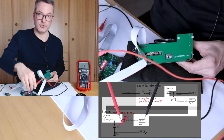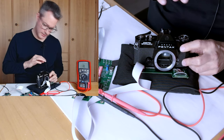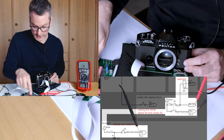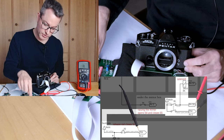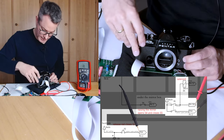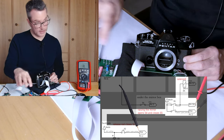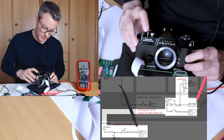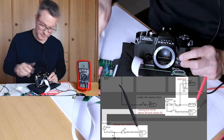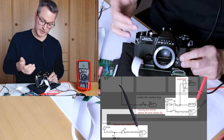There is another power supply contact operated by the mirror action — a switch for providing power to the solenoid that is only activated when the mirror is up. I have connected my multimeter probes to pin 2 and pin 10, checking connectivity between pin 2 (the switched battery supply) and pin 10 (the positive side of the solenoid). You see that just depressing the shutter lightly, which closes the shutter release switch, is not enough to get continuity here. But if I make the mirror go up in bulb mode, we have connectivity between pin 2 and pin 10 exactly as long as the mirror is up. So this switch is working and can power the solenoid while the mirror is up.